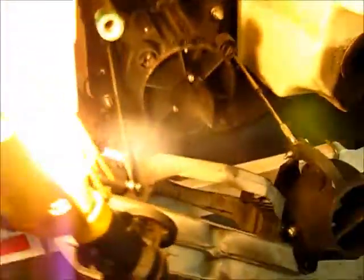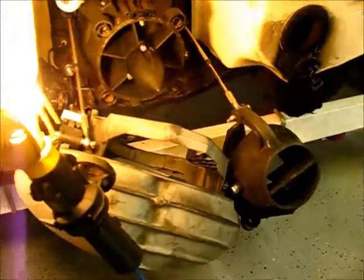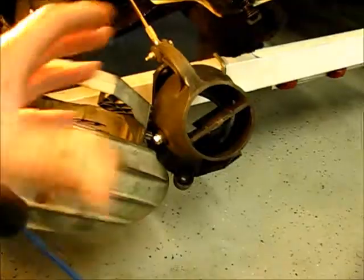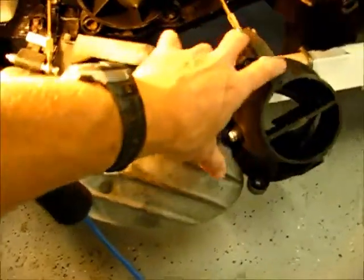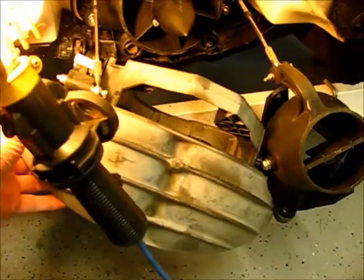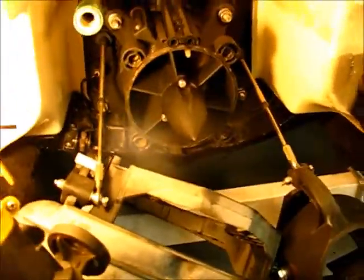The first thing I did was I removed the reverse gate and the steering nozzle from the jet pump and put them off to the side. It's very easy to do — you just take these four bolts out at these four locations here, and then you spin the reverse gate out to the side and the steering nozzle will go down. You don't have to take linkages off or anything like that. If you put the reverse gate kind of halfway down, all four bolts are easy to get to when you remove them.